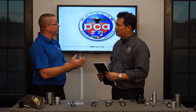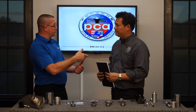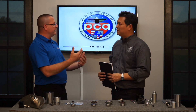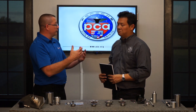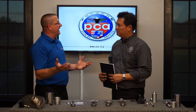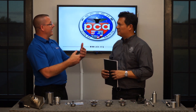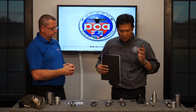With this procedure, most mistakes made during an IMS retrofit are made in the first five minutes. The biggest mistake is not putting the engine at top dead center — just like when changing the chain tensioner on a Boxster, that's the first thing you do. The next mistake is not pulling the tensioners out. If you do either of those two things — performing the process at the wrong crank position or not removing the hydraulic chain tensioners — you'll completely throw off the cam timing of the entire engine, costing you a thousand dollars in tools to retime it. With the proper instructions and procedure, you can avoid that entirely.